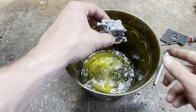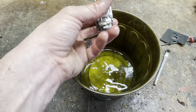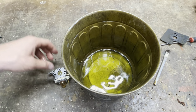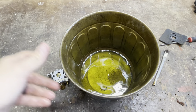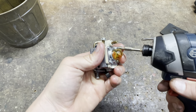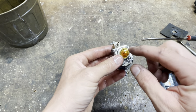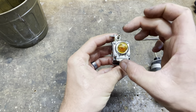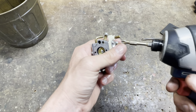Snowblowers — they don't even put air filters on snowblowers because when you're using one there's snow everywhere and when there's snow everywhere there's not dust everywhere. You always want to take a look at where the fuel nozzle is coming out because the design will allow you to reinstall this piece 180 degrees off. So I take a quick note — you've got both fuel connections on the same side of the carb.